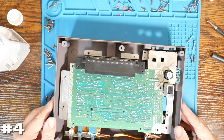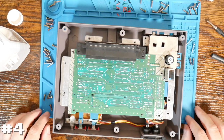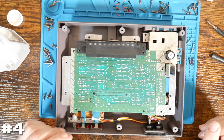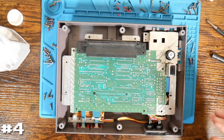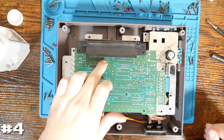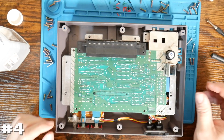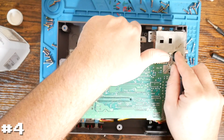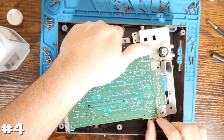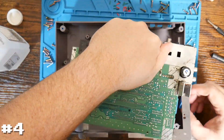Okay, well, rather than moving the camera over to the TV just to test it out, I just went ahead and did it myself real quick to see. And unfortunately, it didn't solve the problem. I did get a glimmer of some imagery on the screen, but then I got back to the gray screen again. So I'm going to guess maybe at this point, it is the connectors on the board that need cleaning. So we're going to go ahead at this point, and we're already most of the way disassembled, finish getting the rest of it apart.